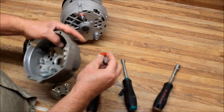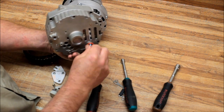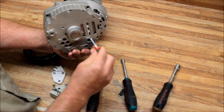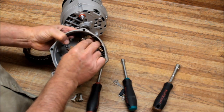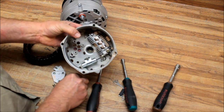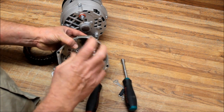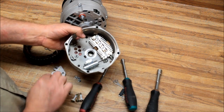Then your battery post — make sure your insulator is on the battery post. It shows through the back side; it's got a square end on it, so make sure that gets seated in there. That's your positive — it's insulated in there. Then put the nut on the back and use the 7/16th nut driver. That's not totally tight yet.